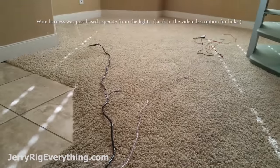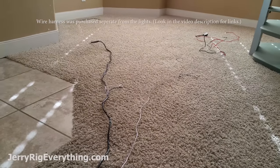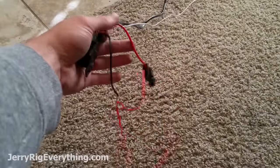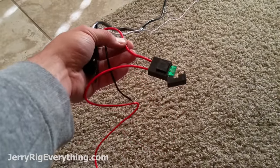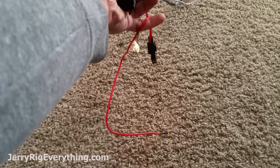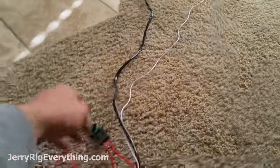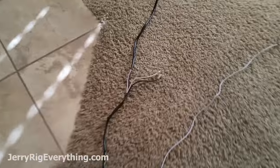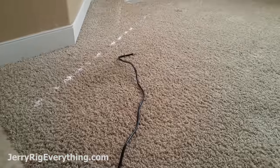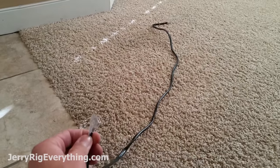Looking at the wiring harness can be a little bit intimidating at first. You can see we have the main relay right here with these two connections and it just kind of V's off in two separate legs. It's actually pretty simple. This is the main part of the wiring harness. You have a fuse in there that regulates how much electricity gets to the light. And then these two connections, the black and the red, they're what's going to go to your battery terminals — black goes on the negative, red goes on the positive. We'll work with the black leg first; it just goes to the lights themselves. You have these two black and white cables going to one light and then to the other LED light on the other side of the bumper. So this particular wiring harness has two legs when you're installing two lights.